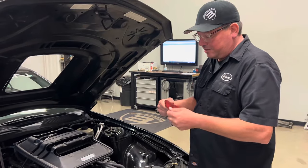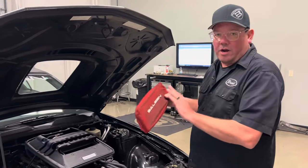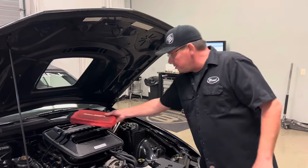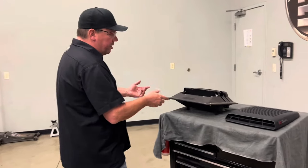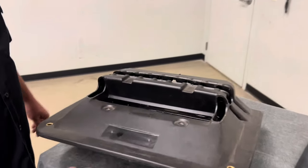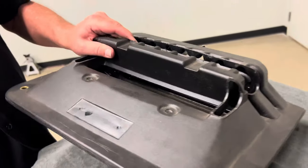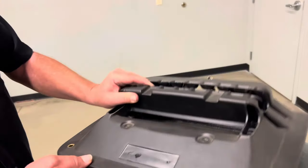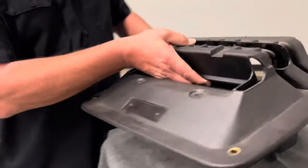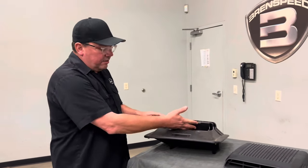So right now you're already dealing with this restriction when you're trying to make big power. These cars came with a 3.6 pulley from the factory — about seven and a half pounds of boost — so the restriction really isn't an issue at that level. But when you want to start running a lot of boost, like on this car with upgraded internals, this whole airflow restriction becomes a huge problem. The air has to come in, hit the rain guard — which is designed to block rain and drain it out of holes in the bottom — then go down through the filter into the throttle body. That was the design, basically to keep the engine safe. Seven pounds of boost, no big deal. But when you want to run big boost, this is a huge airflow restriction.